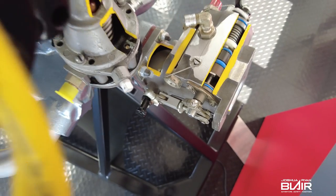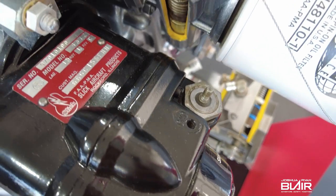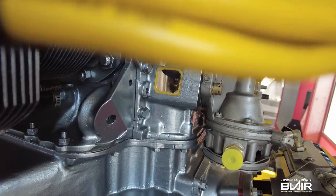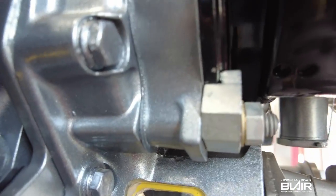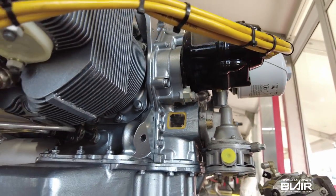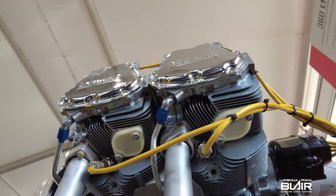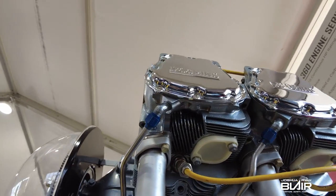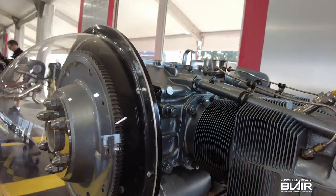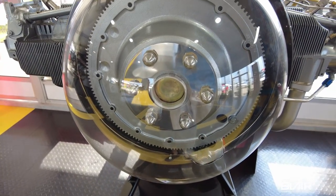What's the difference between an O320 and an O360? The outside of the engines looks very similar — the 360 is just a little bigger. The main difference is power: the O320 is 150 or 160 horsepower, while the 360 starts at 180 and goes up to 200 horsepower. That's primarily achieved through compression and different cylinders. The higher the compression ratio, the heavier the cylinder needs to be — for example, going from 8.5:1 on a parallel valve to 8.7:1 requires a higher-compression cylinder, which increases engine weight.